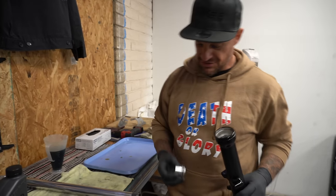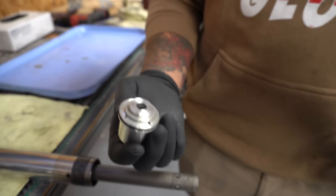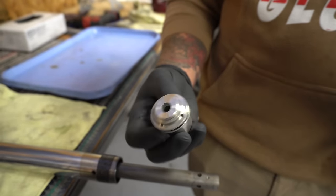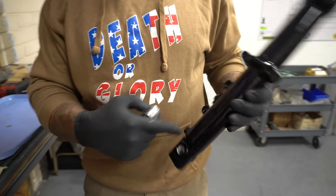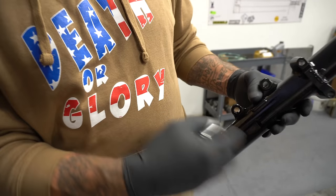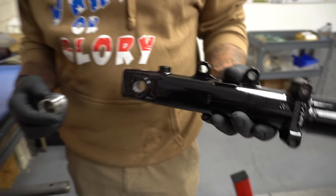This is your stop. Normally you just have that regular old cup that sits on the end. It's different in the DX cartridges. It's valved, and this little guy that goes right here, this valve is underneath it. So this guy sits like this, and this controls the amount of valving and fluid that flows through this guy.